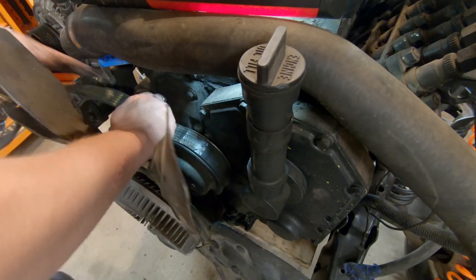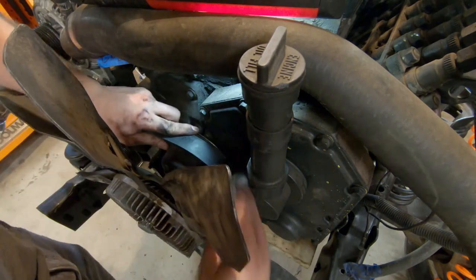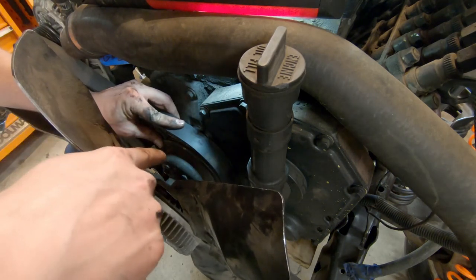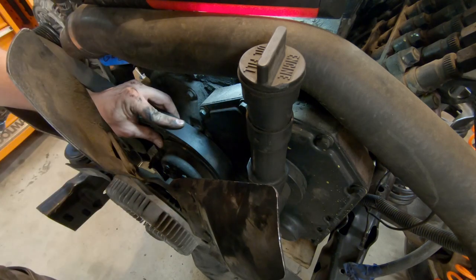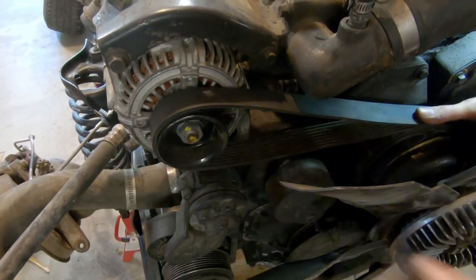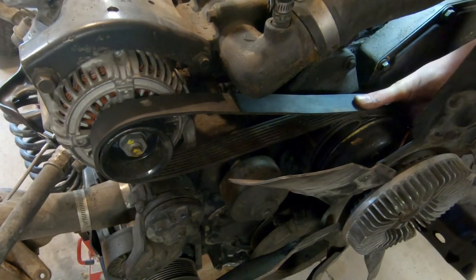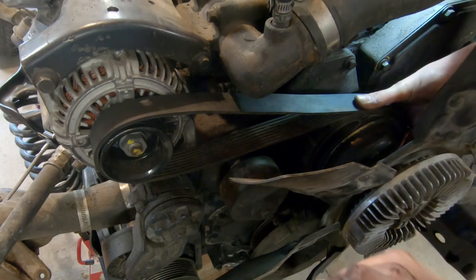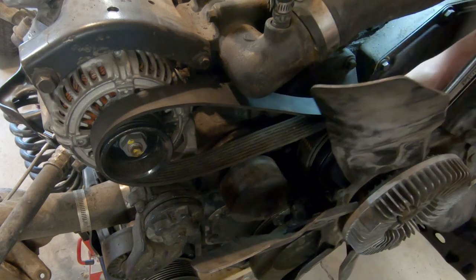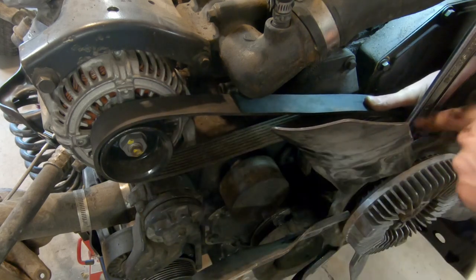I can do a lot better than that. If I just take this pulley, I can actually roll it around there a couple of times — wrapping this belt around that pulley two or three times gives me around 800 degrees of wrap. And not only that, I can also take the loose end and wrap it around the alternator. Keep in mind that the fan clutch bolt is reverse thread, so I need to go clockwise to loosen it. I was able to break it loose by hand just like that — didn't need a hammer or any special tools.